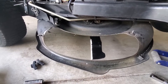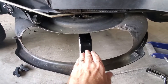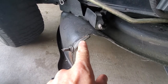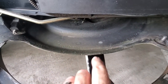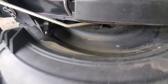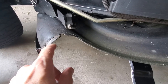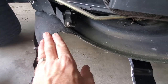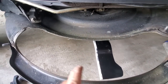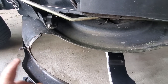I don't typically have wet grass stuck under the underside of my mower. But what I do is when I put a brand new blade on once a year - see this edge here - this is obviously the edge where whatever kind of cover you have, mulch plug or whatever, sits. And this is where all the wet grass and leaves and whatever else gets stuck. It's wet debris held against the metal and it's going to cause corrosion. So when I do my annual blade change...